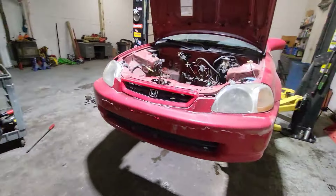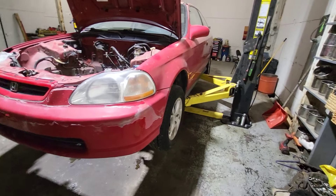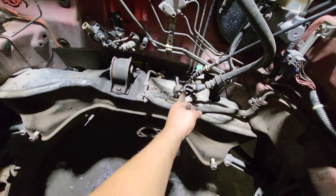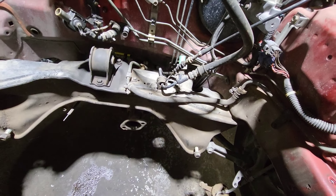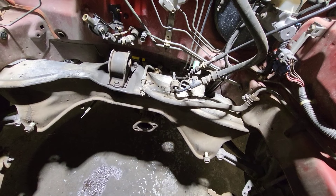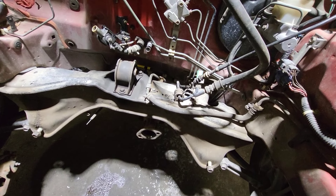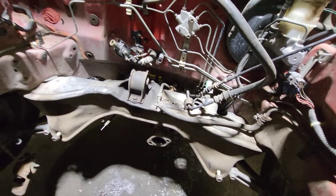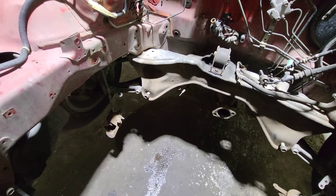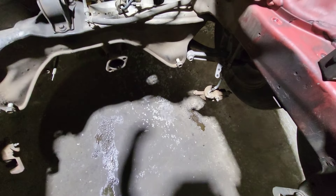I would have done the AC, but they already beat me to it and gutted all that out, so I'm not worried about that. No cruise control, just power steering. Actually, I might not even use the power steering. The way we do it is you cut the hose here, loop this one over here, and tighten it with another hose clamp — and it works somewhat. But don't fold them, just leave them open. If you fold them, what happens is the steering will kick back at you because it's trying to release pressure and it doesn't escape — all of a sudden you'll have a yank or a kickback to the steering wheel. If I have a power steering pump and it's not in the way of the turbo, I might just put it on. It's a single cam, there's plenty of room, so we'll see.